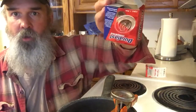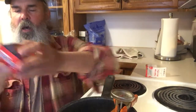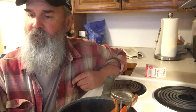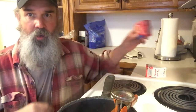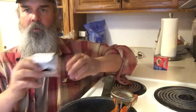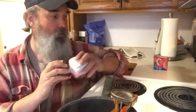The thermostat I got for my '79, I just went down to AutoZone and got. It's their Duralast brand — part number 15356 — and they have those in stock. It probably cross-references with a bunch of different vehicles. This other one I picked up through a local parts supplier. It's brand new, also 160 degree. It's a Moto Rad, made in the United States.